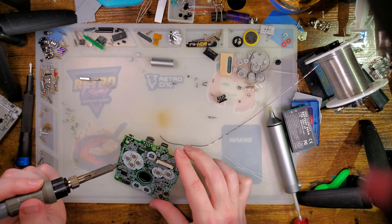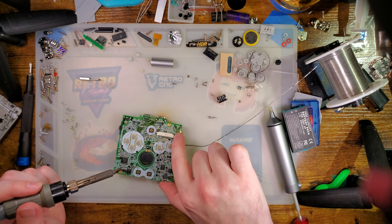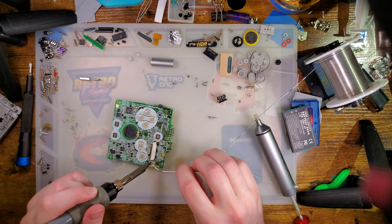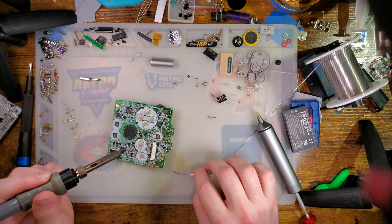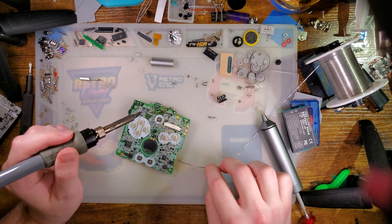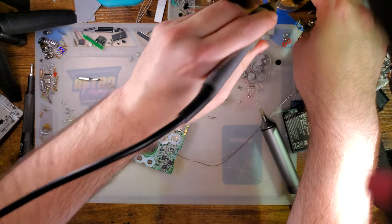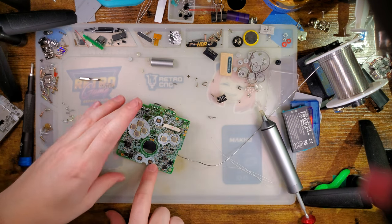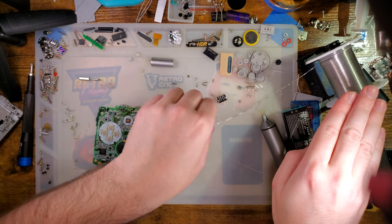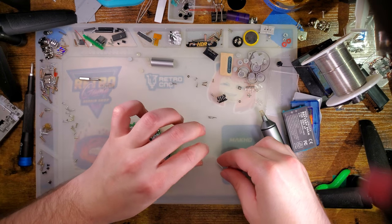where are the labels? There we go. The labels for this section are right down here. TP8. That is the second from the bottom. And then we want Q12B. So we can use the brightness button, because this is an SP and not a slate. Otherwise we would be using TP2 or TP3 for select and start respectively. But since we have the brightness button, we might as well use it.